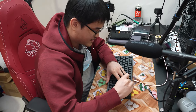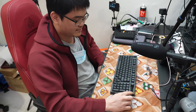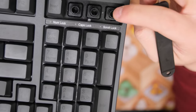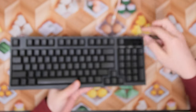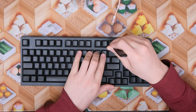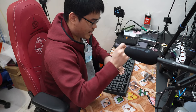Topre switches already look visually very different from MX mechanical switches — you can see little round nubbins instead of a cross-stamp. The switch itself sits in an entire plate along with a housing, so there's no way to just take out the switch and hot-swap it, because the whole mechanism has to be put together.